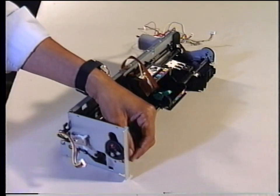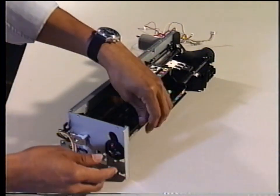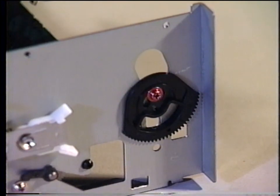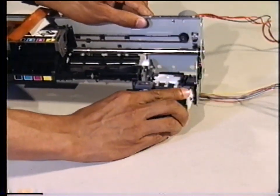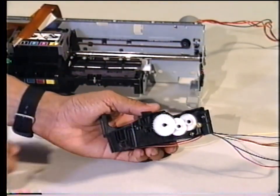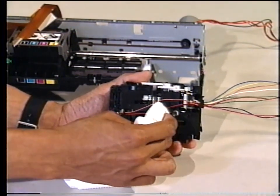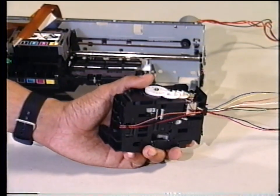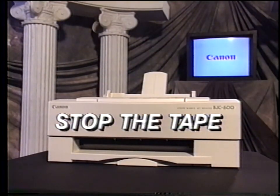To remove the purge unit, you must first remove the carriage support shaft. Remove the retaining clip on each side of the shaft and then slide the shaft out. On either side of the shaft holder are the factory-set printhead gap adjustment plates — do not attempt to move or turn these adjustments. Remove the black screw holding the purge unit and then slide the purge unit out. Examine the purge unit — notice where the motor and gears are located. Be careful when turning the gears because ink will spill from the bottom of the purge unit. Clean any ink mist from the purge unit, the platen, and paper feed rollers. Now prepare to stop the tape — remove the power supply, the purge unit, and sensors. When you're ready, return to the tape. We will continue with the disassembly of the printer. Now stop the tape.